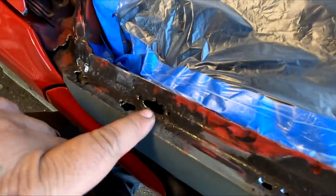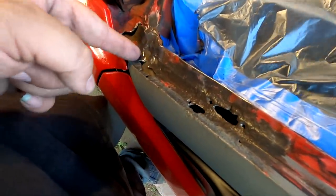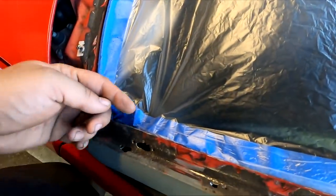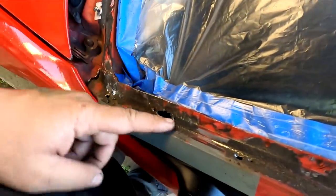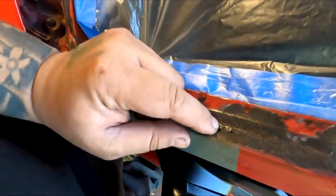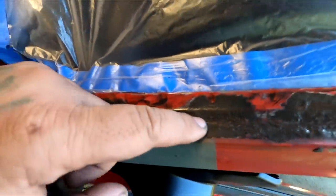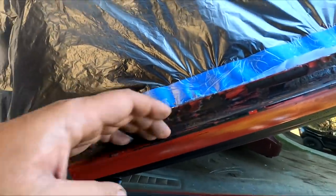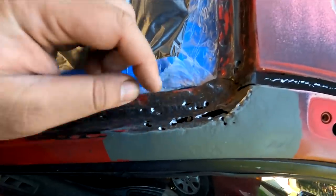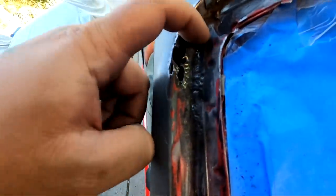You can see right here on the lower driver's side we have some pretty nasty holes. So what I'm going to do is I'm going to cut a square out of this and then transfer that to the door to cut out the same amount of sheet metal and form fit it into this section. This is super thin because it's rotted out so far underneath the molding — the metal itself is super thin now. This one right here I might be able to get away with setting the welder on really low to not blow through; I might just be able to tack it shut. All of this is just eating out the metal but not all the way through, so this section just needs to be treated.